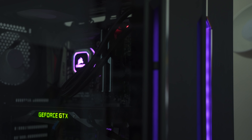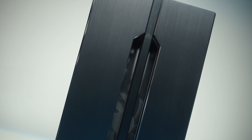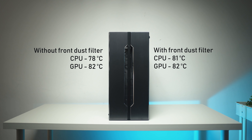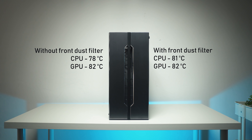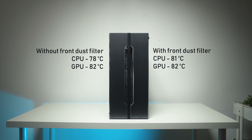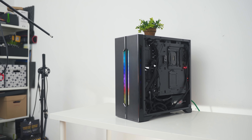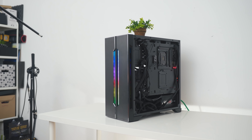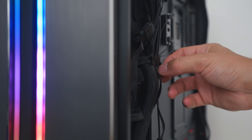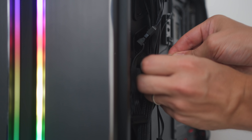For temperature testing, the front panel is not a restriction — there's plenty of airflow from the center and on the sides too. But the dust filter, just like we saw with the O11 Air, is a performance hit. It's not significant — only three degrees from my tests — and I ran this for 40 minutes so the liquid inside the AIO could heat up. At the back, cable management is totally fine. I like that we have Velcro straps, and you can also use that front section — that slight indentation — to hide all your cables or anything beside your power supply.